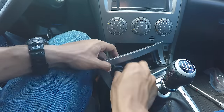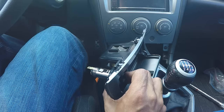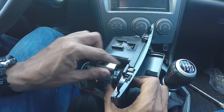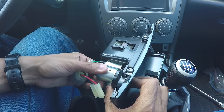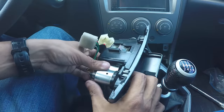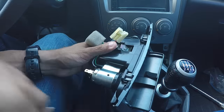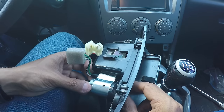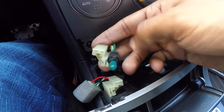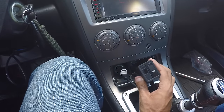To install my new outlet, I'm simply going to perform the steps in reverse order. There is a small notch on the inside of this ring, and that corresponds to a bump on your new cigarette outlet — so you want to line that up and it should pop right in and sit flush. On the back side, take this housing piece and slide it over; this part should line up with the ashtray area and slide in. As you hold that in place, you simply replace the locking ring at the bottom. I didn't over-tighten it — I just snugged it up so it won't vibrate loose.